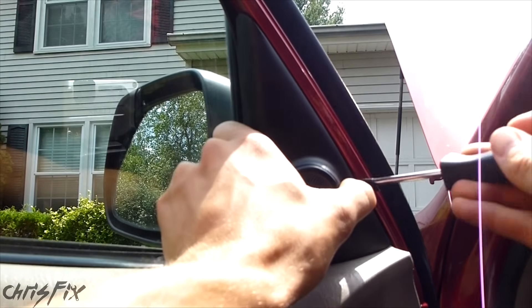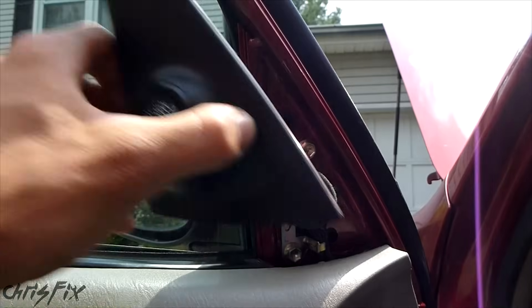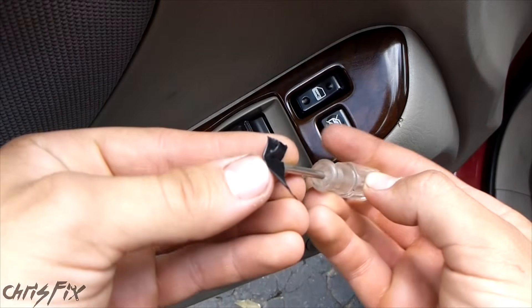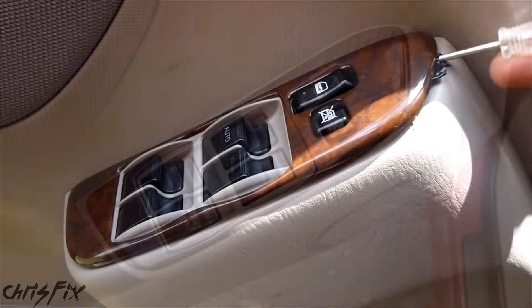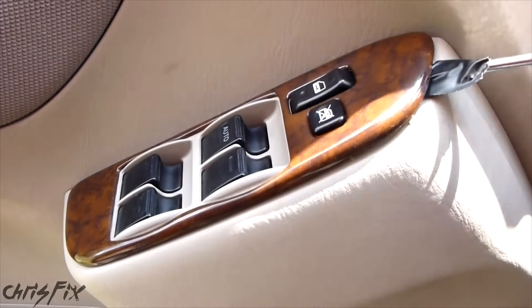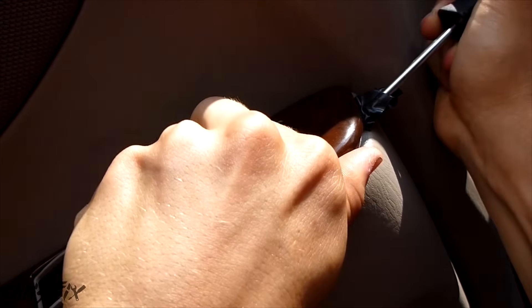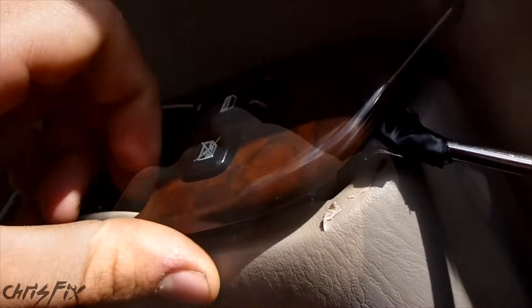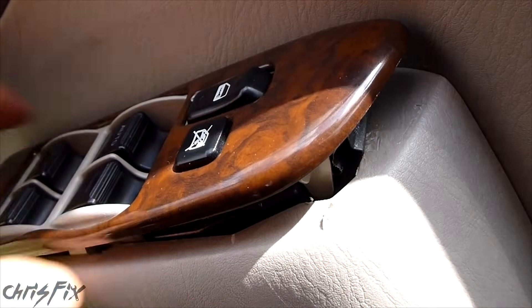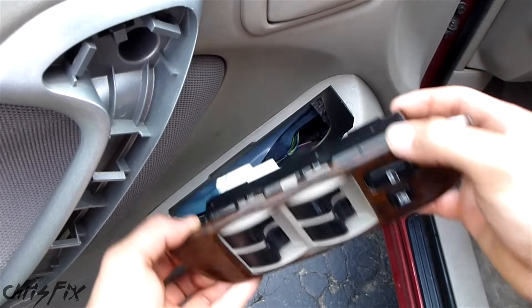This speaker right up here — just get in here. This pops right out as well. For this I'm going to use a smaller and thinner screwdriver because it's a really tight gap. Once you get under here, get your thicker one. There's a metal clip right here, and as you push forward against that clip, you're going to take your finger and pry this upwards. And then that pops up and will come right out.